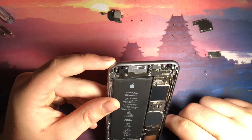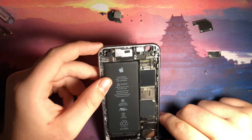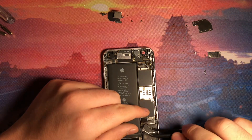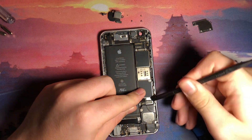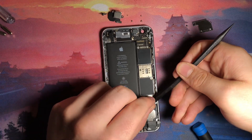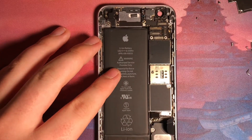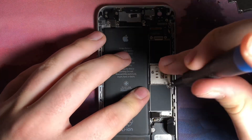Let's just look at the motherboard here for any screws that need to be removed. I'll first remove this little antenna band right there, and the next ribbon cable right here — I'm not sure what that connects to, but I'm going to gently remove that. We're clear down there. I see one screw right here underneath the SIM card tray — I'll set that aside.